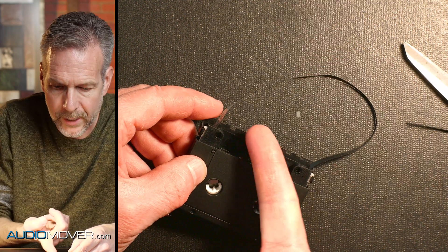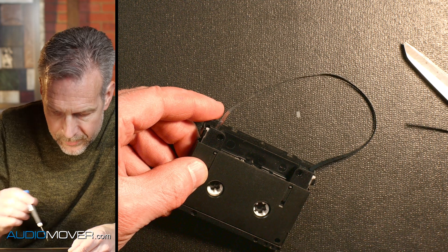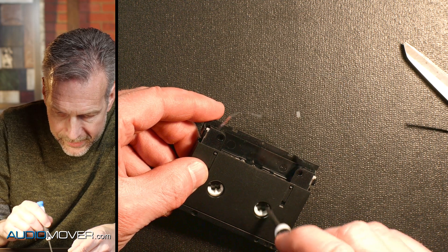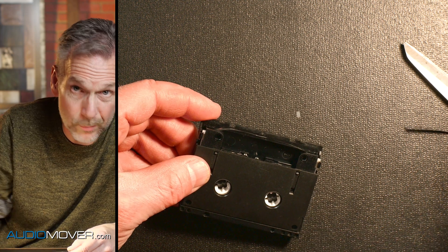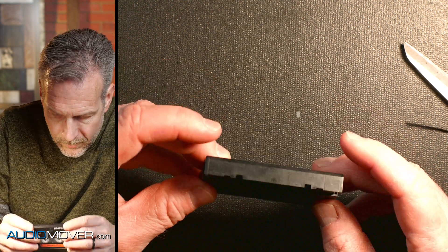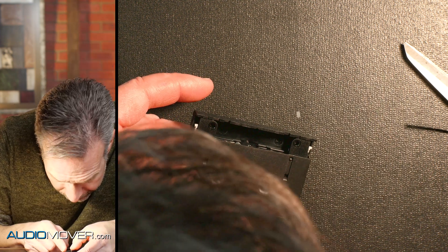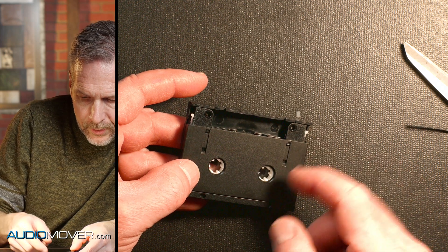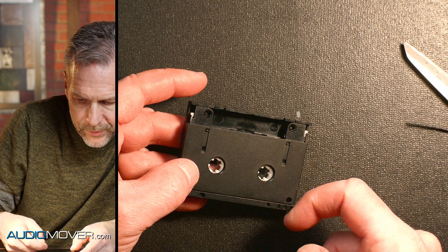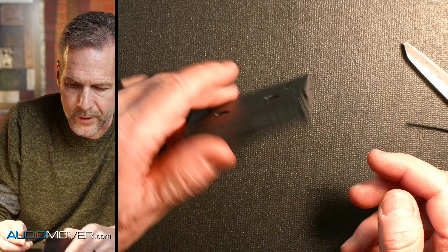So I won't have to go through the precaution I talked about earlier, and that's all there is to it. You put the adhesive on the inside here so the head reads it on the outside. From here we can just spool it back in, and now this will play fine. Close it up — these latches, you'll see that same little tab that helps you open it also locks it once it's closed. So I just push those in and it closes like so.